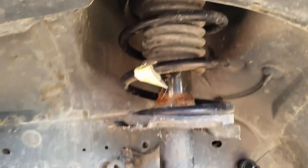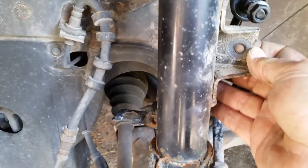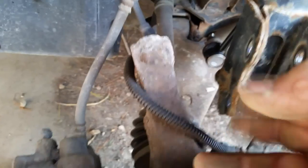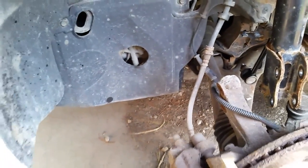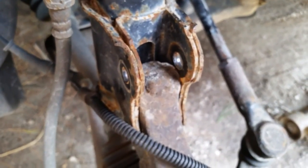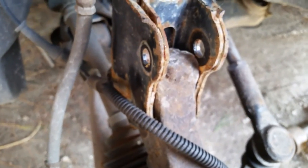You can see everything is starting to come into place — the strut is in position. The only thing left to do is connect the stabilizer link to it. We can pull that over into the general area. The strut is going to have to go up about an inch and a half to line up with the stabilizer link, which is why we have the jack underneath. The steering knuckle here needs to be pressed into the bracket on the strut — that should pop right into place.